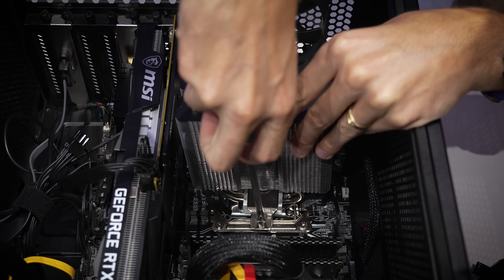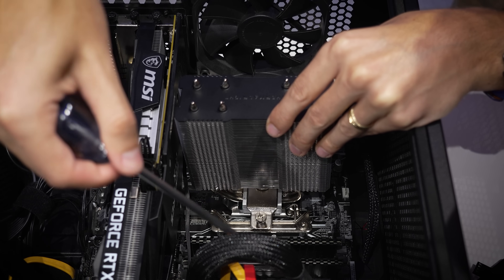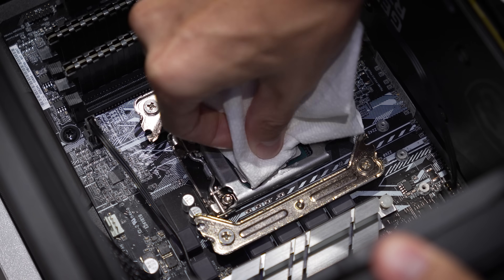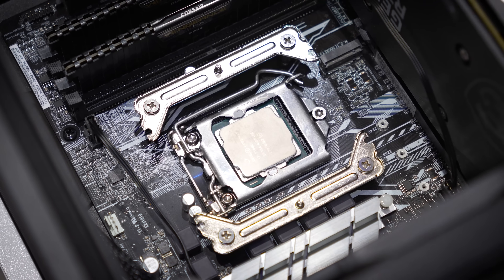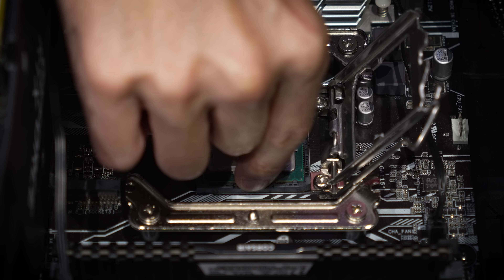This goes without saying — assuming it's something we can quickly fix, we'll of course repaste, and I'll probably move the fan back to the other side so it can push air through rather than pull it. I don't like the idea of having two fans so close together. Let's quickly clean off the CPU here. And yes, this is in fact a 7700K. And now, here we go — the moment of truth. Do we have socket damage?